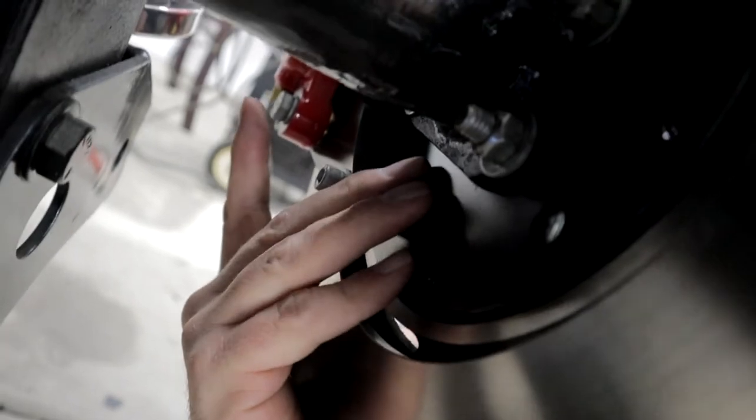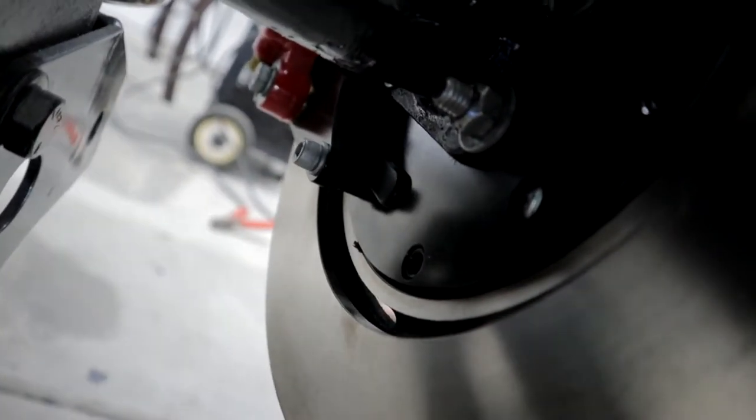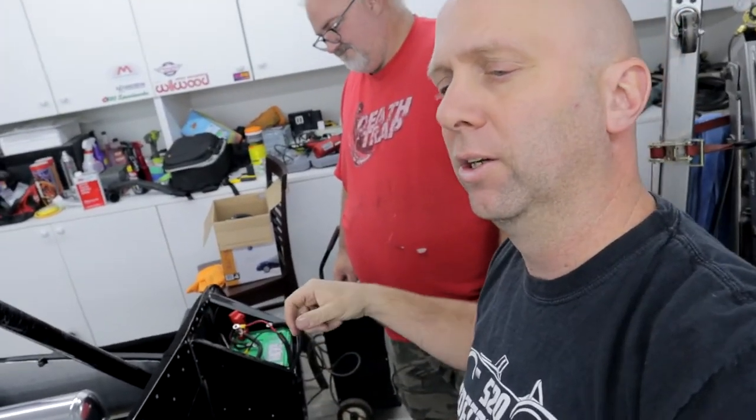What's left — and I'm not going to show this part — once you engage it, on the very bottom there's a little plug. If your rotors are still spinning while it's engaged, you need to adjust the little spin wheel in there. Stick a screwdriver in, it's got cog wheels, and you just keep going until it gets tight. You want them to drag just a little bit when it's disengaged. Once you've finished the install, that's it — it's good to go, just do the adjustment. If you have any issues, e-stop is super easy to get a hold of — call them for warranty issues. And if you have any questions on the install, send me an email or give me a call and we'll work through it. Thanks guys, bye.